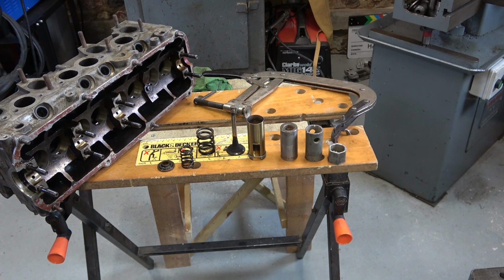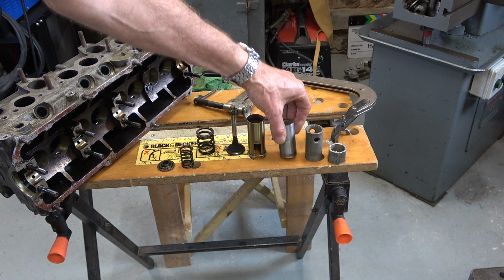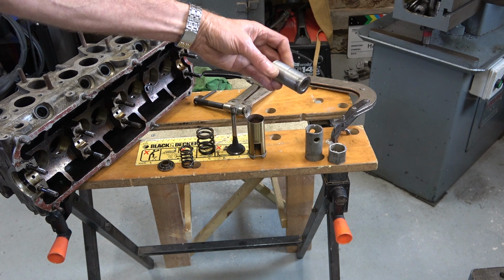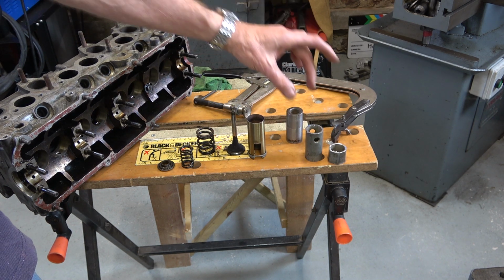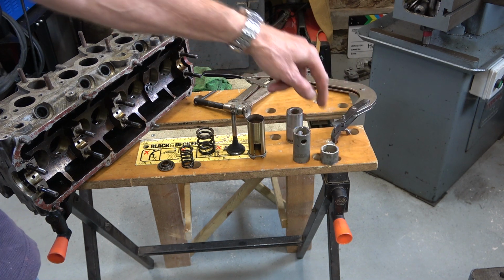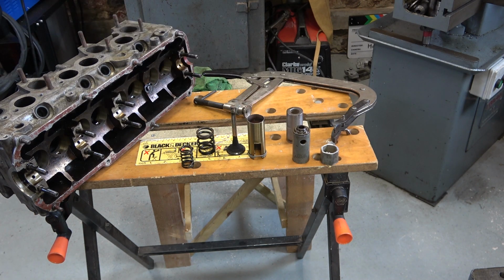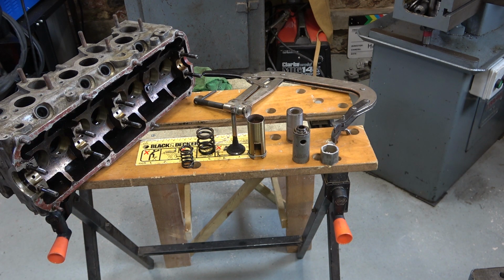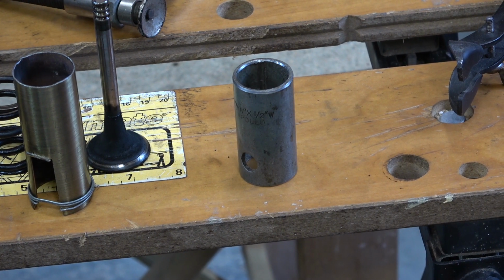Well, I don't like to admit defeat, but I'm giving up on this. I'm getting a terrible surface on it. It's running very hot. I chipped my tool. It's not worth it. So what I'm going to try now is using this old 1/2-inch Whitworth box spanner. I've cut the end off it already. That's the kind of idea. I'll see what I can make of that. I could make something up out of new, but the stuff I've got that's new is pretty soft. It'll be all right. Two minutes on the lathe, and I've just cleaned up both ends.